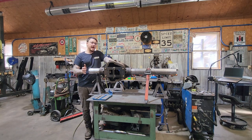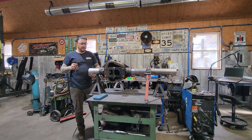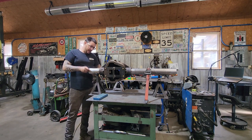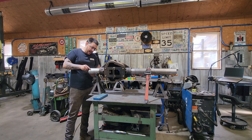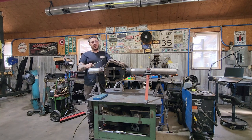So the knuckles, when they go on, they have a 2.5 thousandths interference fit. When we pull them out of the oven, they should be oversized enough where they just slip on, but you literally have just a few seconds to get them where you like them, and they're going to lock down super tight. So the reference mark is very, very critical. And also, you want to spend some time with a mic and some sandpaper or whatever while they're at the machine shop. You could always have the machine shop true the ends of the tubes. But we have actually gone through and dressed these down to where they are just about dead nuts on 3.5 inches exactly. When we checked them initially, they were actually a couple of thousandths over.